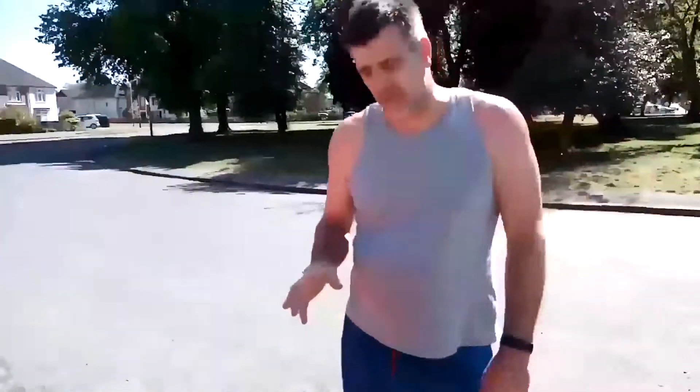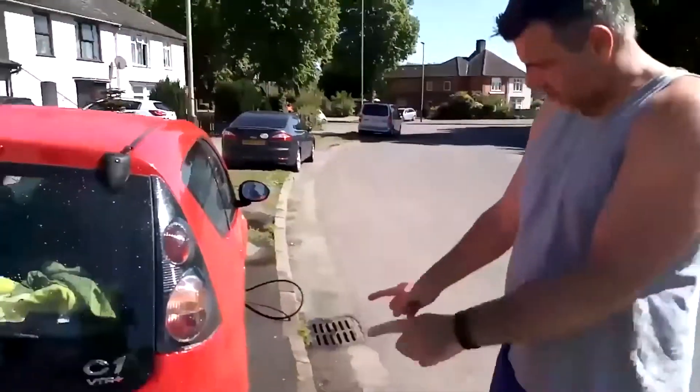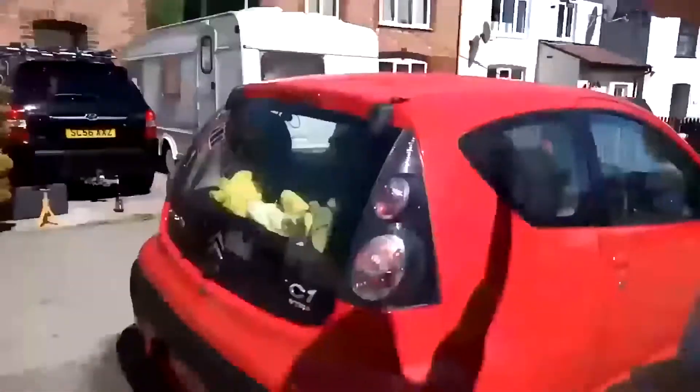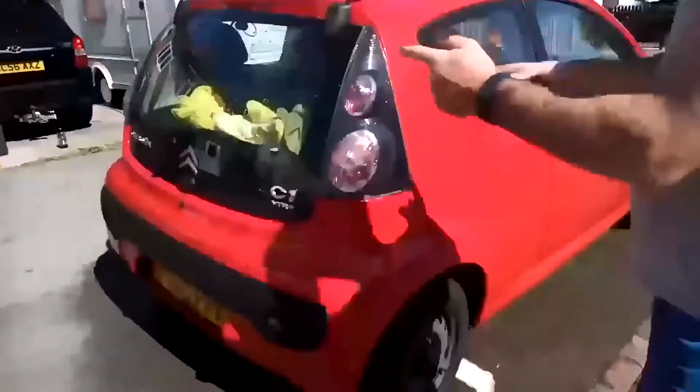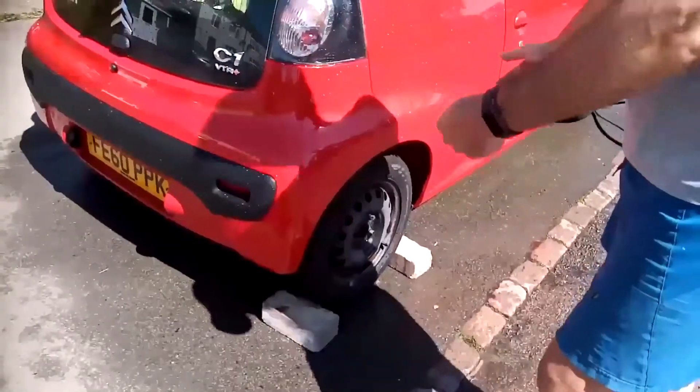What we're going to do — let's show you how to take a wheel off today. It's about jacking the car. Before we do anything, we need to make sure — we're going to take the passenger side, the nearside wheel off. So the opposite wheel to the corner we're jacking, we have to chock. I haven't got any wooden chocks with me but I've got some bricks — I'm supposed to use wooden wedges.